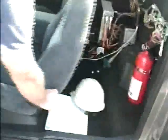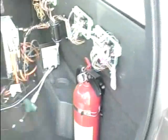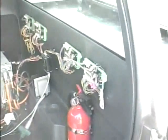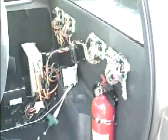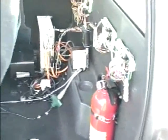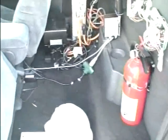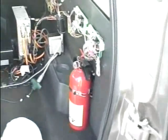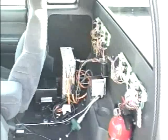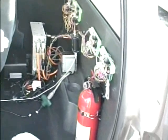Can I see inside? The four green panels there — that's the REAP Systems BMS, part of your battery management system. The BRUSA charger — everybody knows what that is: a battery charger. The other one's just a small charger to help charge up our 12-volt battery. Some conversions use a DC-to-DC converter to convert pack voltage into 12 volts, but that robs from your main battery pack. There's no sense in doing that — a lot of people do it because it's easier and avoids fabrication, but fabrication isn't that hard to do.